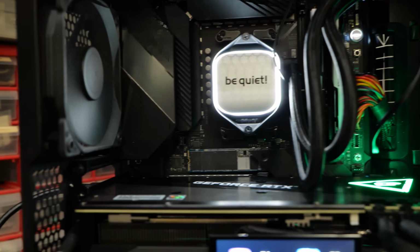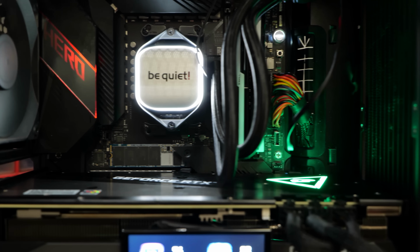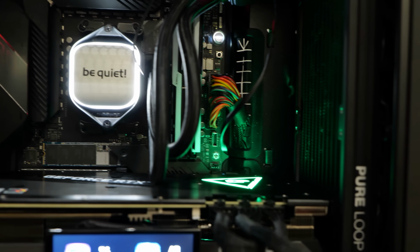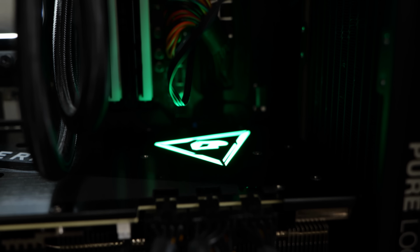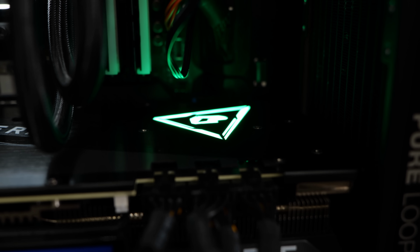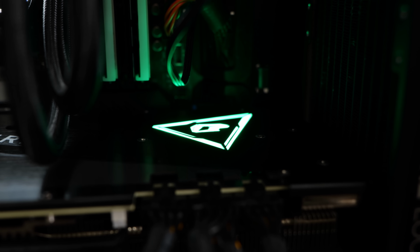The test system is a Ryzen 5950X system, basically running at stock, with a be quiet! 360mm closed-loop all-in-one cooler. Really a pretty pedestrian system. Otherwise, we've got G.Skill memory running at 3600 CL14, so it's pretty fast memory. 16 gigabytes, so that's single rank, not dual rank.